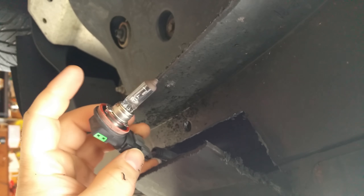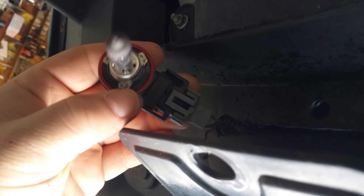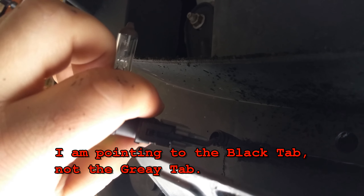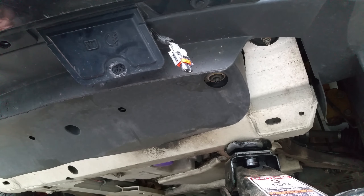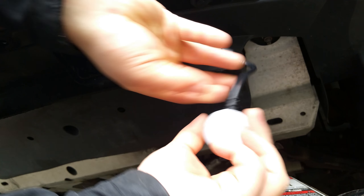You can see right there how I twisted it and then just pull it out. Now we have full access to the H11 that's in there. Fortunately the LED is plug-and-play so we shouldn't have any problem getting this changed out. To disconnect the bulb there's a tab on both sides — take your flat blade screwdriver, slide it up underneath the tab, pull out just a little bit. Don't pull on the harness. Slide it underneath the tab and pull the entire bulb out — it should disconnect just fine. Then take the new LED and snap it right into the harness — really easy.